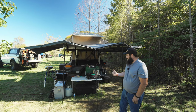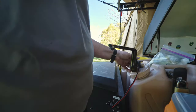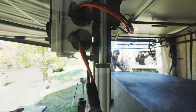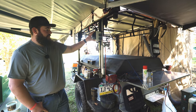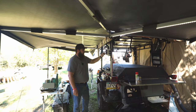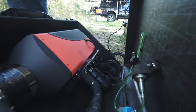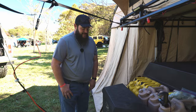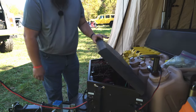Let me take you around my M416 military trailer that I've modded out for overland camping and travel. We have a scepter can for water storage and a 12-volt pump. Linear actuators on all four corners, so the rooftop tent frame rack up here will articulate 18 inches. Eight-gauge circuits run into the back on Anderson connectors on both sides. This one pigtails into the distribution panel, running the lights on the awning as well as giving people places to charge cell phones. The Anderson plug on the other side runs a diesel heater that I built into a Pelican case — goes up through a mylar vent to heat the annex in the tent. The tongue box here is a Harbor Freight tongue box, but modded it up — it evolved into my electrical box.